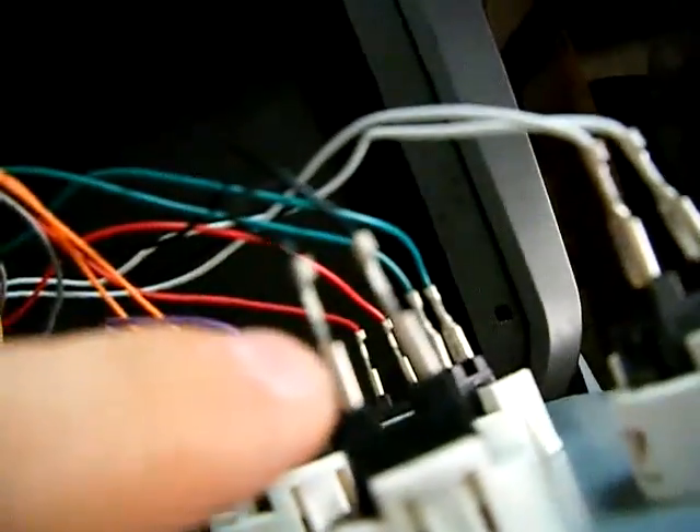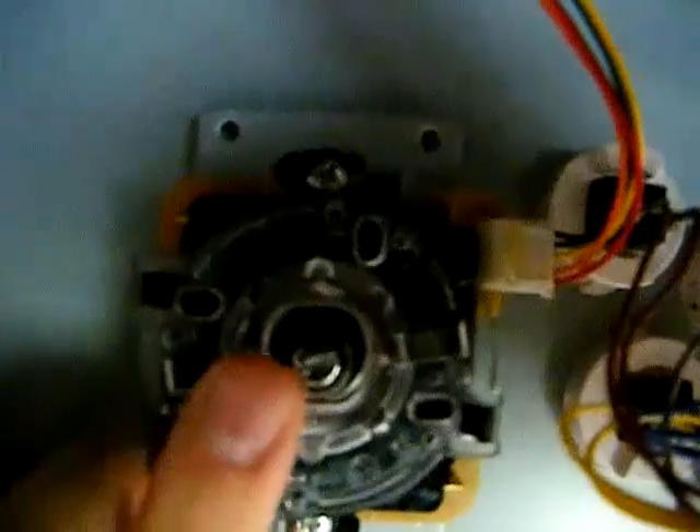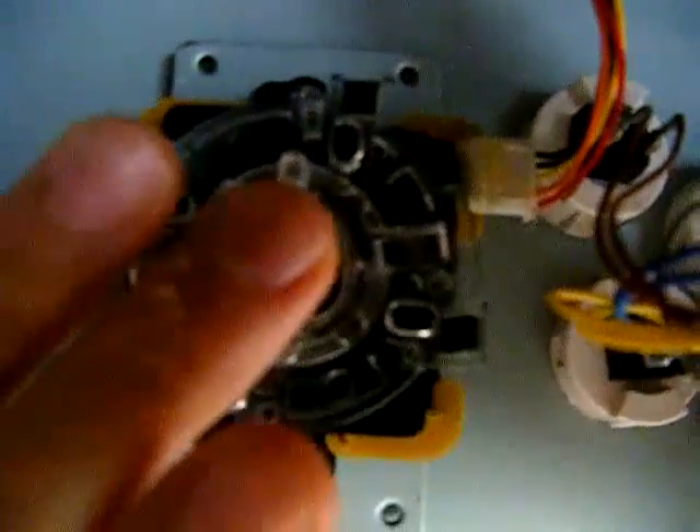The quick disconnects you take out using a screwdriver. For the ball top: stick a flathead screwdriver in the slot, hold it steady to prevent the shaft from spinning, and unscrew the ball top. You can also tighten a loose ball top by turning it the opposite way while holding the screwdriver — that's why you need to hold it, because the shaft moves as you turn.